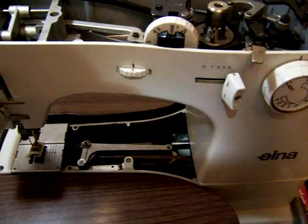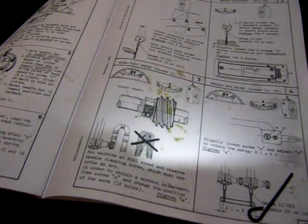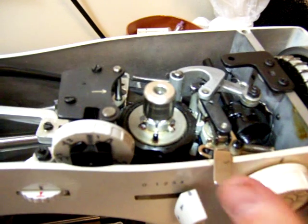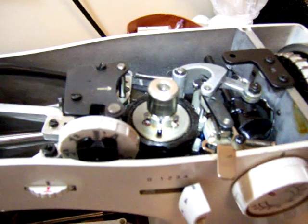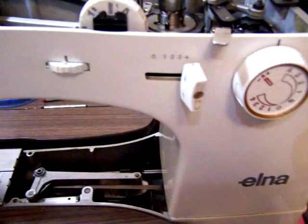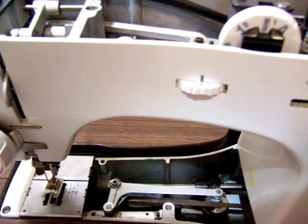This is a Star Series 62 and I just replaced it and I'm working on adjustment 3 with the disc drive. I'm running full forward, full zig zag, and centered.